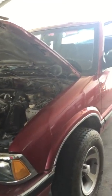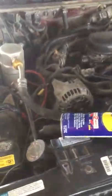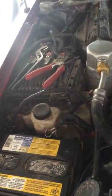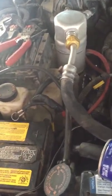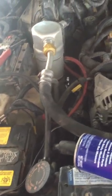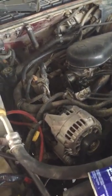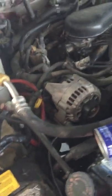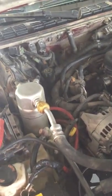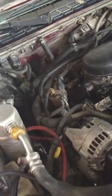In this video I'll show you how to get a heater core out of a 96 Chevy S10 — the 4x4 model, V6, extended cab. Right off the bat, I had troubles finding the exact heater core. The parts store told me the extended cab is different, and it is — on this model the tubing is overlapped one over the other, but the one they showed me was side by side, which wouldn't work. I had to special order it through the internet, so be very sure they give you the right part.